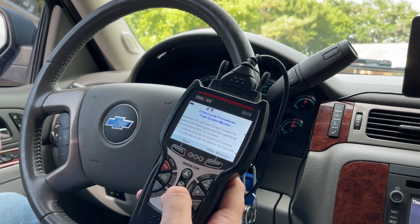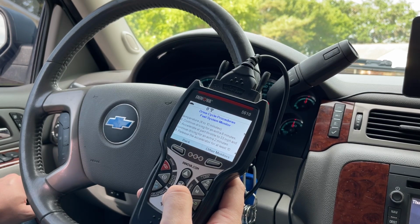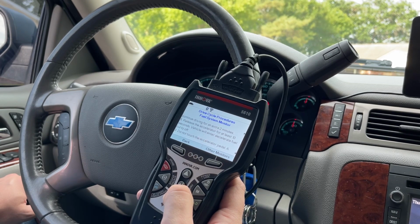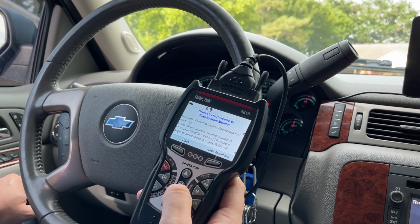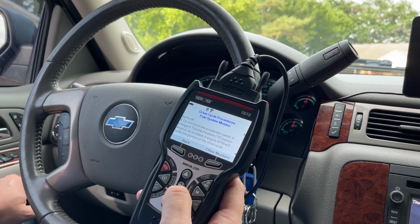Continue driving for an extra 6 minutes. Accelerate at part throttle to 55 miles per hour and continue driving for an extra 2 minutes. Wow, this thing's really in depth. Release the accelerator for at least 10 seconds. Vehicle will enter decelerate fuel cut off. Do not touch the accelerator pedal. A change in throttle position sensor angle or any increase in engine RPM will nullify this portion of the drive cycle.